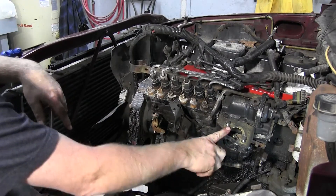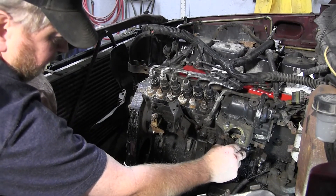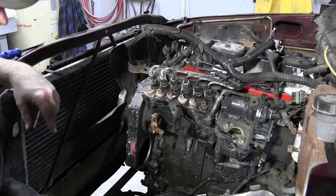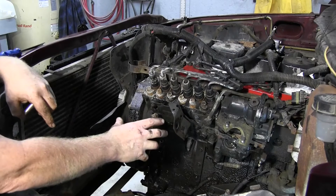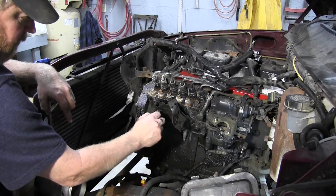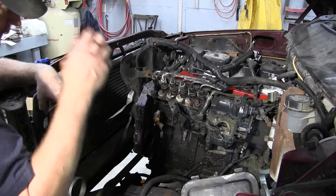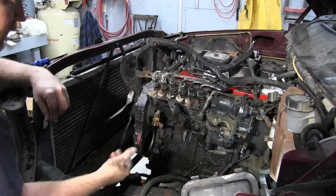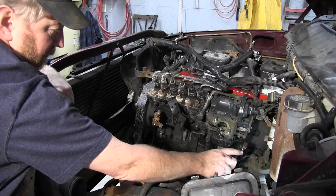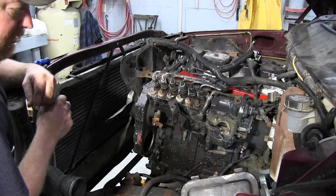We're not going to fully finalize it right now because we're going to be messing with the AFC. You want to make sure your solenoid is allowing the fuel lever to go all the way to the 'on' position — otherwise you're not getting full fuel. The throttle cable comes down through here, hooks to this, and a linkage runs to the actual throttle in the pump — basically a flow valve. We've rebuilt this and ordered new ball ends and sockets for the linkage because it was real sloppy.